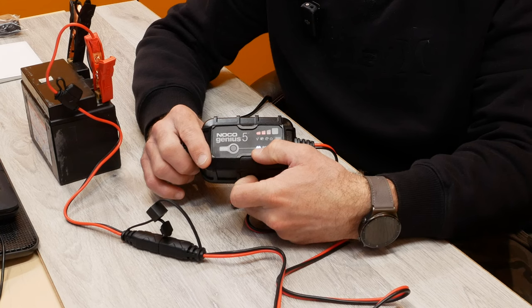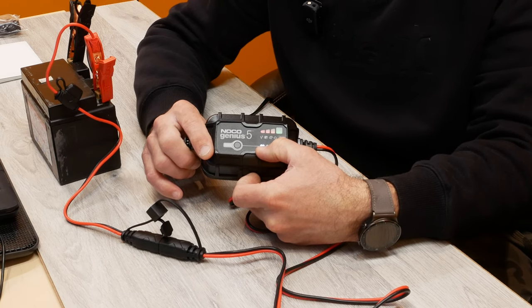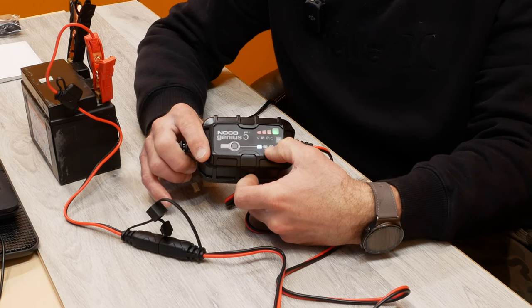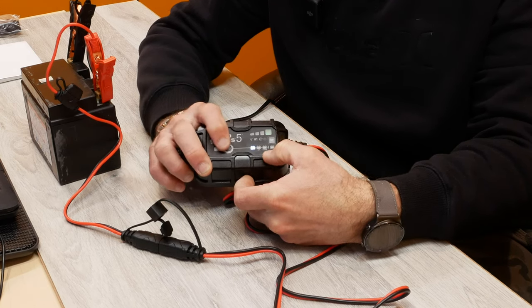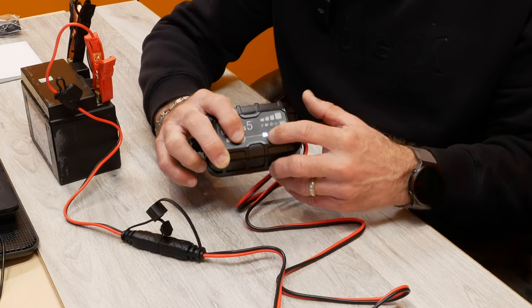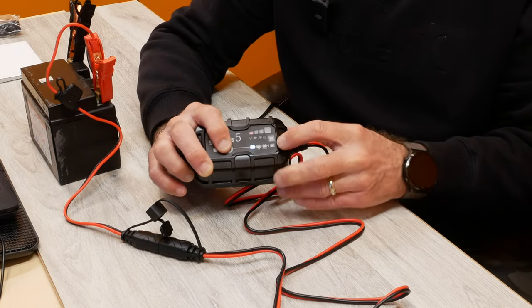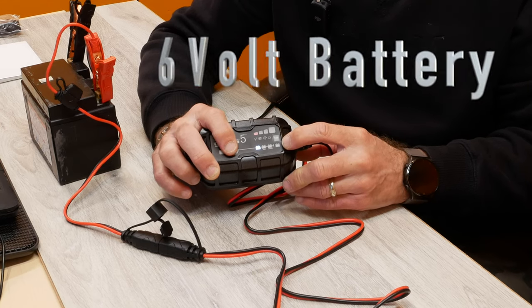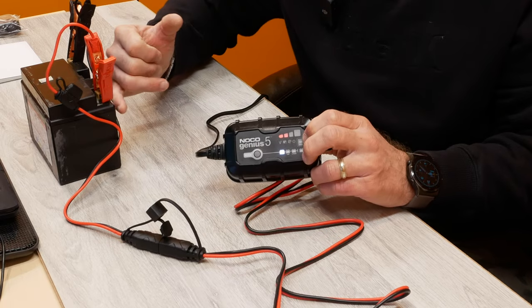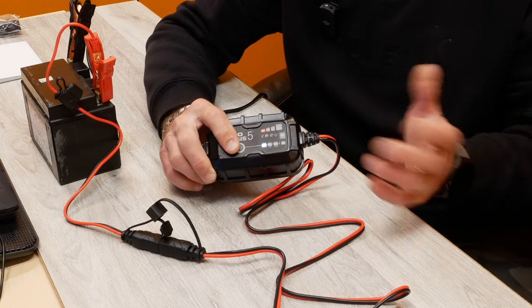Just below, you have the different battery type indicators. The first one is for charging a 12-volt flooded, enhanced flooded, or gel type battery. The second is your 12-volt AGM battery mode. The third is the 12-volt lithium battery charging mode. To cycle through those menus, you just do a single click and it steps through the different modes. Hold the button for three seconds and it will go into charging mode. Press it one more time and it goes to 12-volt repair mode — so this charger is capable of repairing a battery. From what I've read online, it can repair most batteries, and a lot of people have had success with it.